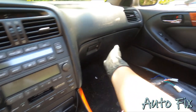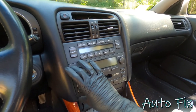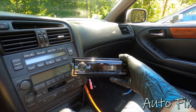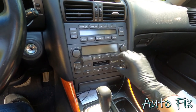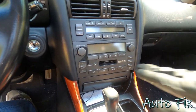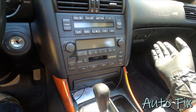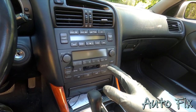First thing we want to do is remove the glove box and this panel right here. You need a faceplate for this - I have a faceplate that adapts this whole thing to a single-DIN head unit. They also make double-DIN options. The extra space created will be a little plastic pocket, which is nice because you can slip your phone or wallet in there. The faceplate adapter is super cheap - I think it was $11 on Amazon. All parts and tools in this video will be linked in the description.